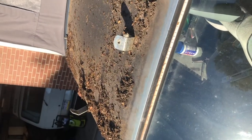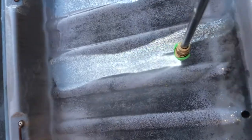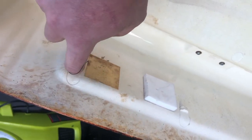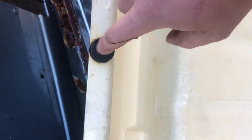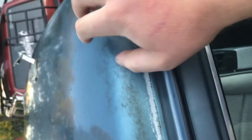Not impressed by this — this is some crap, and this is the kind of thing I always find under here. This is why you have to take them off. There are pieces of foam here, I'm missing one. There are these little tiny edges that are actually cast into the fiberglass. Can't forget about these rubber washers either — there are four of them, one stuck to this, the other three came off with the studs. There are also rubber washers on the inside — one there but not on the other side, and none on the fronts, so I'm missing one for this side. I'll glue the replacements on. Below the top there's some paint peeling, down to bare metal in spots — this top is going to have to get painted at some point.